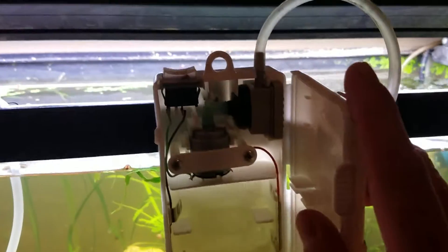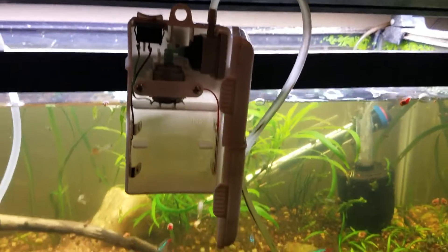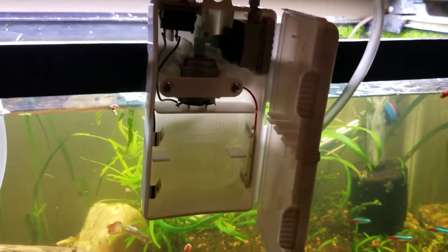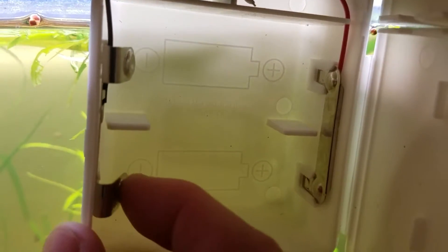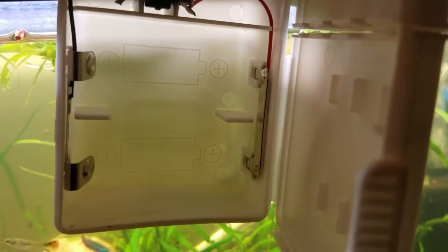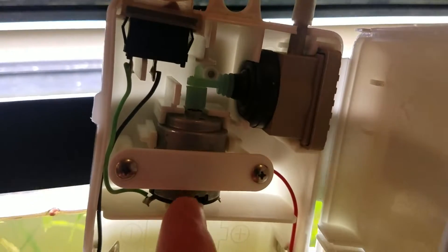I've got this one cracked open so we can look at the inside. Now if you look real close, there's no gasket or anything on the inside of these, which means there's not really any protection from water. So if you get these a little wet, you need to pull them out, turn them off, pull the batteries out, and let them dry so you can save those components. If you get some rusting on these pegs, you can try using a wire brush to scrape some of that rust off so you can get a better connection with the battery — though that has worked sometimes and sometimes not. The same rusting can happen with the compressor in here; this whole metal compressor part can get rusty really quick and just kind of shut down on you.